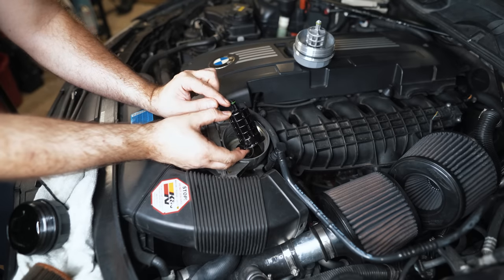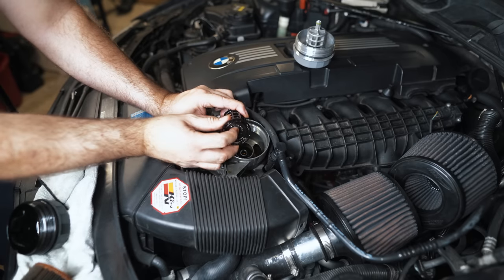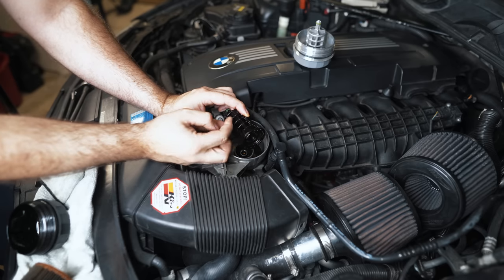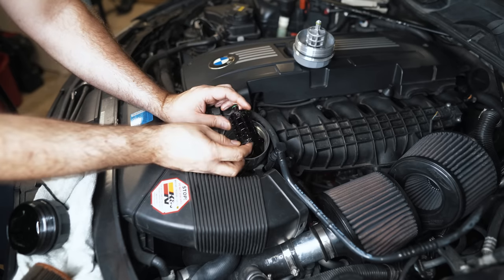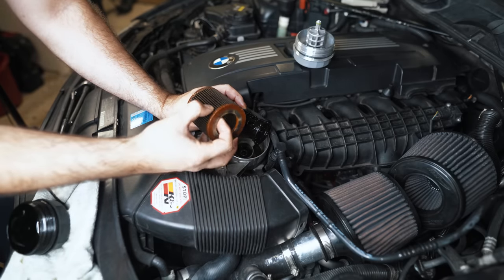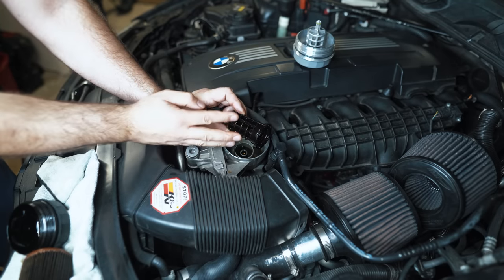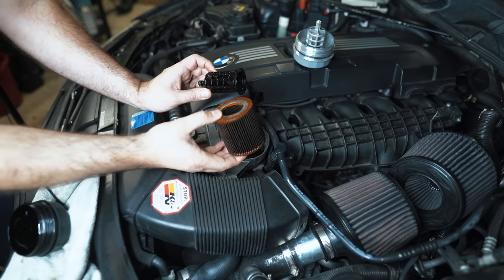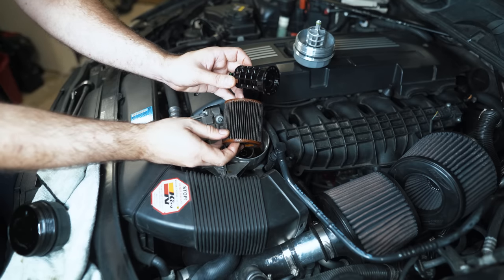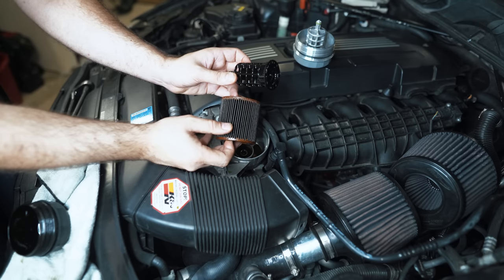This cage serves three purposes in my opinion. You've got the O-ring at the end to act as a little plug. You have the pressure relief valve and spring in case too much pressure is coming in — it can bleed it back down into the middle and drain it back into the engine. This cage also works as a support for the oil filter, because too much pressure can cause the oil filter to collapse on itself, fold over the pleats, and you lose oil pressure. If you have a cheap Chinese filter and you forget to put the cage in, you'll probably get Vanos codes within about an hour of driving, because the filter pleats will fold over and right away starve the engine.